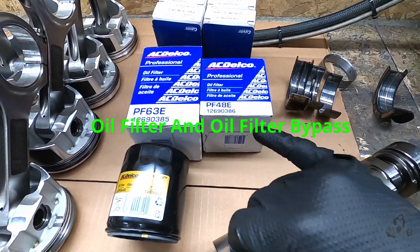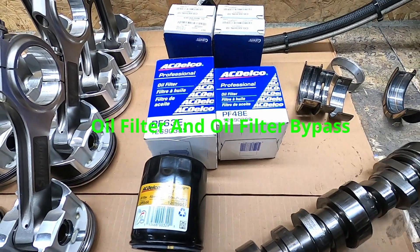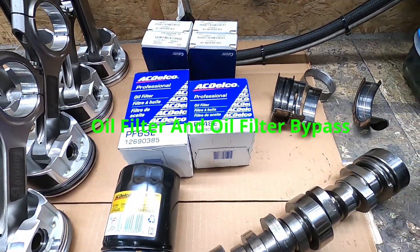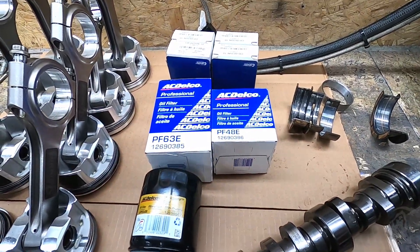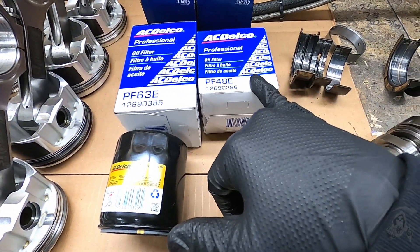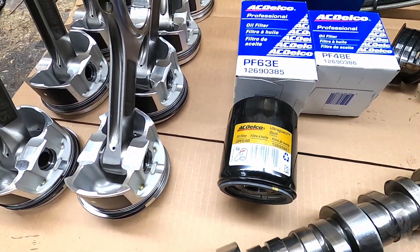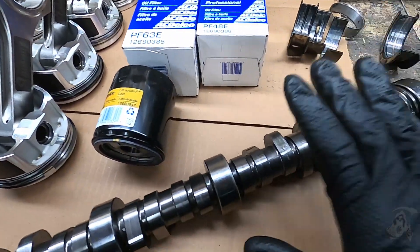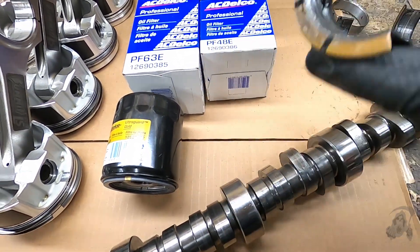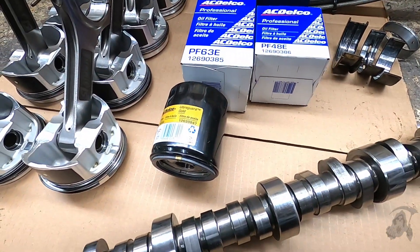And another thing I figured out: just because all these fit an LS engine does not mean they're correct for your application. So make sure you do your research on that. What I have found — and I don't want you guys to take this to your engine, I don't want to be responsible for anything failing on your motor — but these guys have a 12 PSI relief in them for the bypass. These guys have a 22 PSI relief, which will make it less likely to dump bad oil in and cause issues like this. So do your research, guys. Don't make the mistake I did on this engine. It cost a lot more money than it should have.